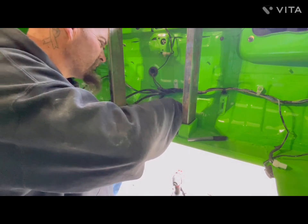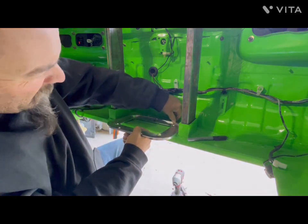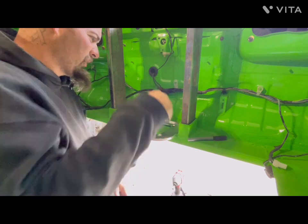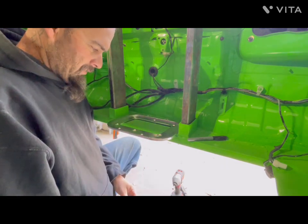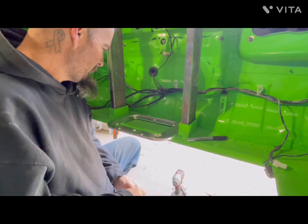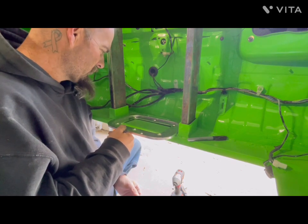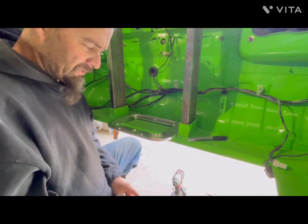See, that's a big drop right there. I'm definitely going to need to add some washers if I put it right there, but then I'll probably drill down into the main bar that I welded in, and then put 2 more in. I think if I use my big drill bit, I can bevel the edge just like the factory ones. And then I'll have to put a washer in to keep it super flat. But this will give me enough room to get behind it to put the hole down in place, and in the front also.